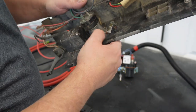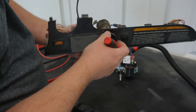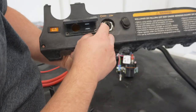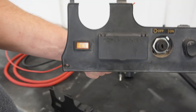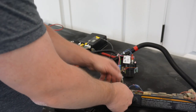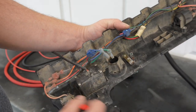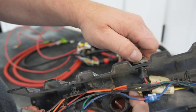There's definitely some corrosion in that key switch — I probably should order a new one because who knows what the inside looks like. There's just a cover on there that pops out from the back and a big nut holding that ignition switch in. Looks like the socket is a one inch — you don't even need a ratchet, it's just plastic in there so it comes out pretty easy. I'm going to pull these Phillips screws out and swap that over; everything else looks like it's plug and play.